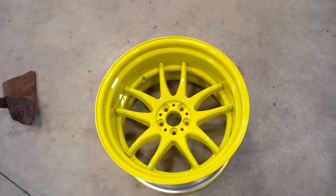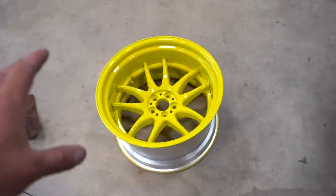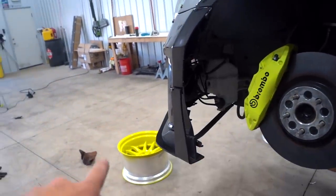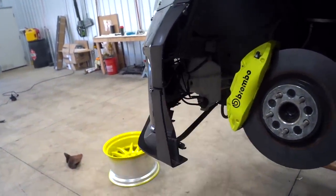First wheel's out of the oven. Again, this is ridiculous — why are we doing this? The color is going to change when it cools down. It's kind of crazy how much it changes — that's the same color, warm versus cooled down. Absolutely wild. Let's run through and get all four of these guys powder coated. I really need to upgrade some equipment here — the sandblaster is almost too small for these wheels and the oven is clearly a little janky. We've got a good powder coat gun; we just need to upgrade some other stuff as well.